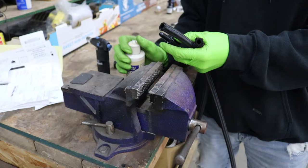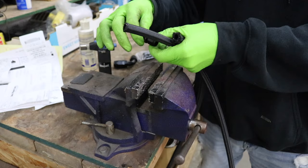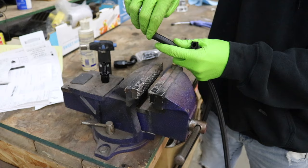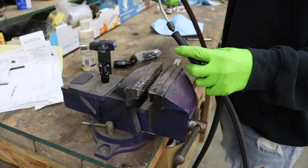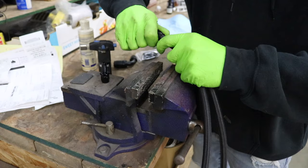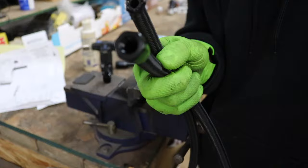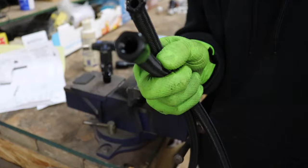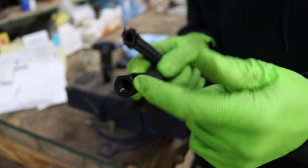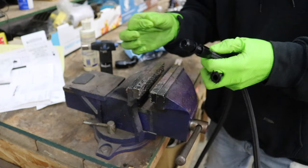What I like to do is take a little bit of assembly lube or oil and put some on the threads of the AN fitting itself, spread it out so they're nice and lubed up. I'll also take a little bit and just shove it into the tip of the line so it glides on nice. Now grab your air gun and blow out the line. Grab your end of the AN fitting and just push this over the end — rotate as you push it on, it'll walk itself on. You'll feel it once she bottoms out, and this can take some effort sometimes. If you look inside you can see the hose is bottomed out on the little lip inside the AN fitting.